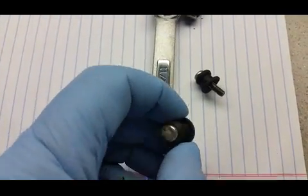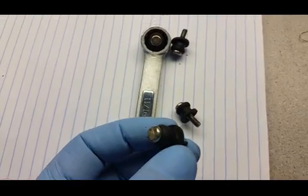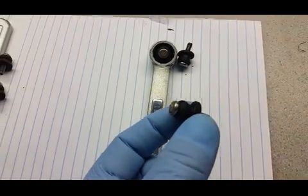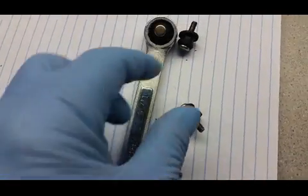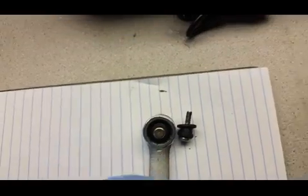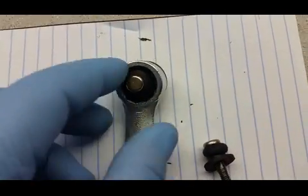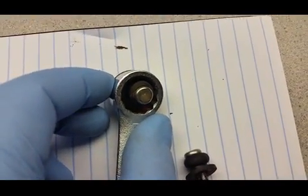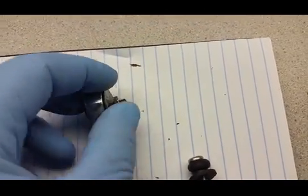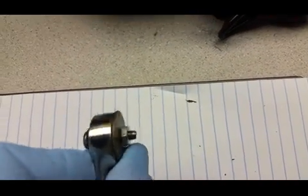So here's the probes. These are the gray water tank. This is the bottom one. I call it the common, where everything crosses to send the current. Here's a 1/3 full. You can see it's got a little bit of corrosion on it. Here is 2/3 full. Pretty clean. And then here is the 3/3 full, where the tank is full. And here's the setup I had to remove these. I just tightened the nut up on it with the washer and then gave it a slight pull. Once I got it, it felt like it was loosening up.